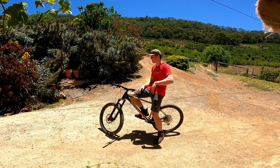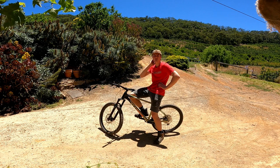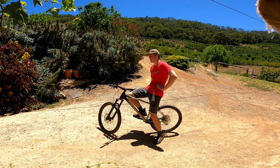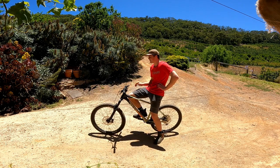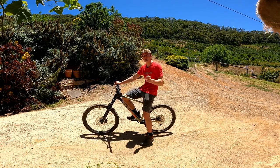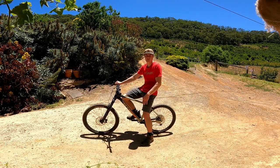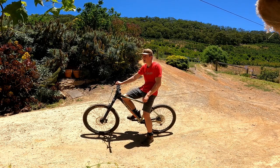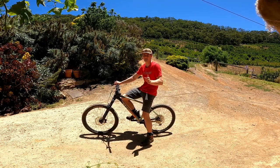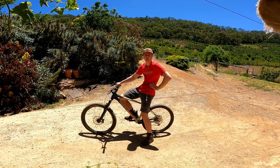They're nice powerful brakes and I'm so glad I figured that out. My next step would have been to buy new brake pads and even a new rotor, which would definitely have fixed it, but I fixed it without doing that. My biggest takeaway is definitely don't use nail polish remover — it might be why it didn't work the first time, and it just stinks. The smell is still on my hands after washing them twice. Just keep nail polish remover for its intended job and use methylated spirits instead — it works a lot better.